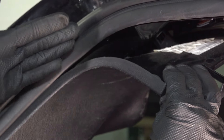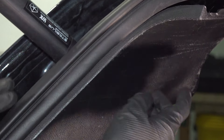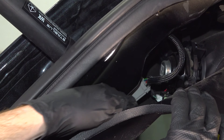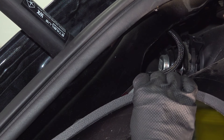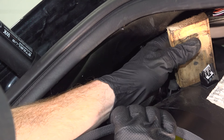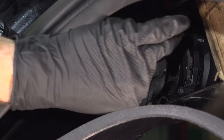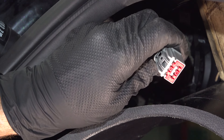Continuing on, we're going to keep tugging this down, but we're not going to fully remove it. We just have to make our way to the area where the electrical connector is located. You can see it right back there — we have our wiring harness with our gray connector. I'm going to use a small chunk of wood as a spacer so I don't cause any damage while I work. To disconnect this, there's a small locking tab — depress that and disconnect it, doing a quick inspection for corrosion. Just squeeze that locking tab in and slide it right out of place.